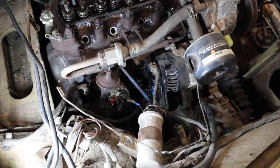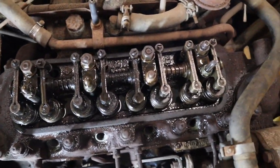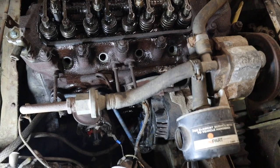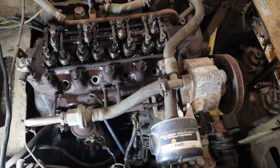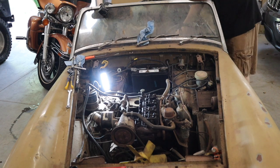She's all back together. Alternator's back in. I spun it over, got good oil pressure, oil all up on the valves. It started to run out where the valve cover gasket isn't cinched down. I got the spark plugs all out of it because the next thing we're going to do is turn her over and find top dead center on that number one cylinder and see what we can do about setting some timing. Let's bump her over a little bit the easy way and see if that gets us anywhere.